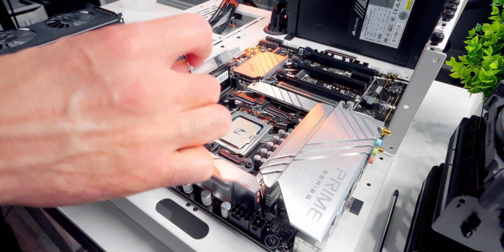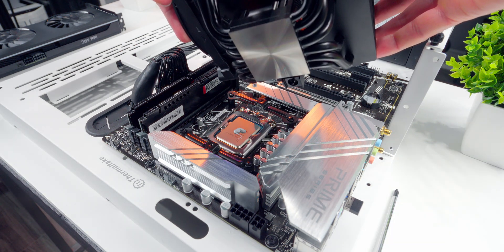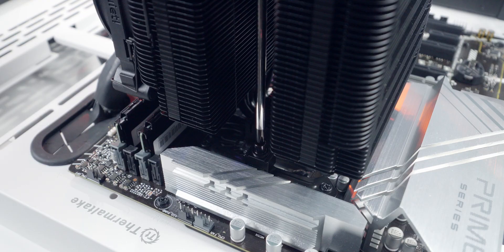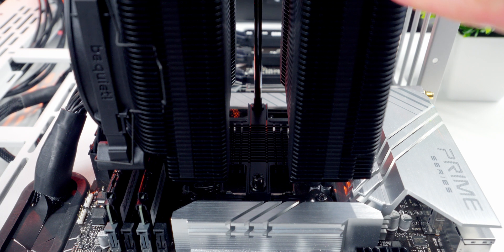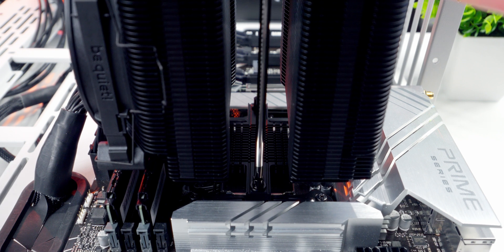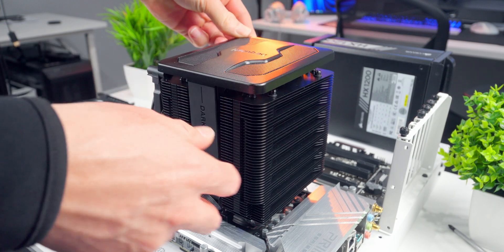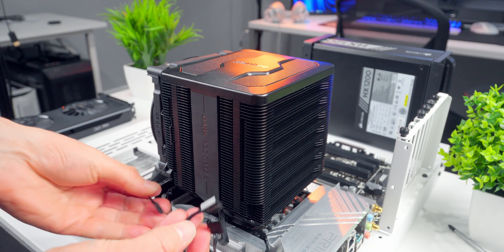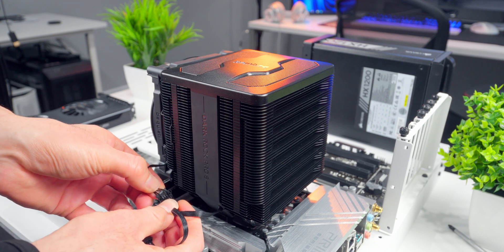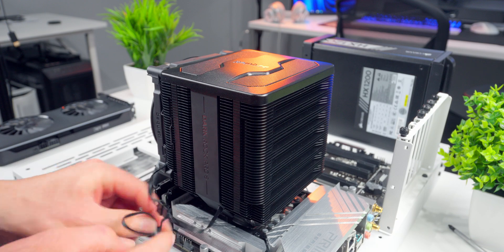Put a little bit of the included thermal paste onto the top of the CPU, just a small amount right in the center — the force of the cooler when mounted will spread it out evenly. Make sure you take the plastic cover off the base before installing, then lower the cooler right down onto the CPU and tighten the two screws on the bridge, alternating back and forth a little at a time on each side for even pressure. The beauty of this design is that the screws are already attached to the bridge, which is permanently attached to the cooler. Then take the center fan, get it lined up, and drop it back in — it clicks right into place. To connect the cables, use the Y splitter proprietary connection to daisy chain the two fans together, then plug a single fan connector into the CPU fan header on your motherboard. Done.